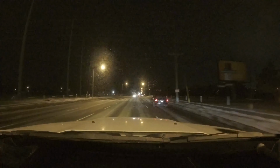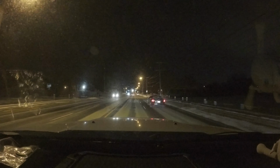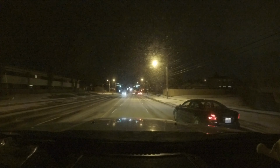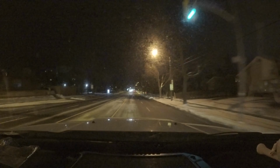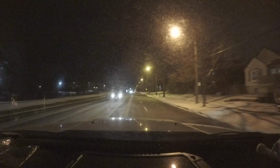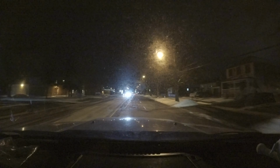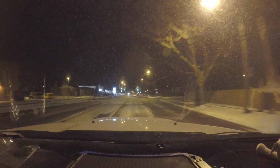However, when going to off-road situations where you need more demand of the front axle, other people have commented on this subject, and there are quite a lot of videos out there about how the Borg 44-44 is a little bit misleading. If you put it into lock mode, it is supposed to send a 50-50 torque split, such as this transfer case I have. However, with that one, it is limited by the friction of that clutch pack. So you can overheat it, you can overexert that clutch pack if you put large demand on it.